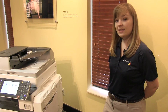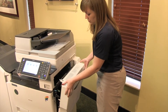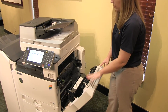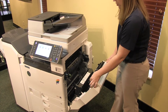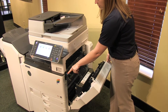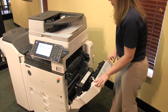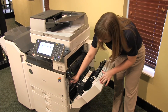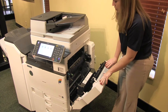On the right-hand side of the machine, you will find a lever that you will lift up to expand the whole right side of the machine. Depending on what model you have, the configuration will look a little differently, but be sure to look for any blue labels which will be labeled with letters and numbers — these will guide you to the misfeed. You may even have a blue lever in the middle that you can move back and forth like a ratchet to turn the rollers and push the paper out.